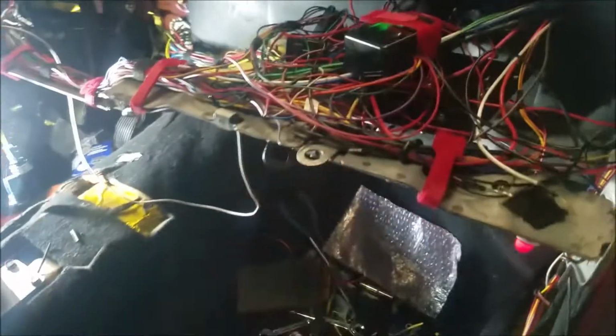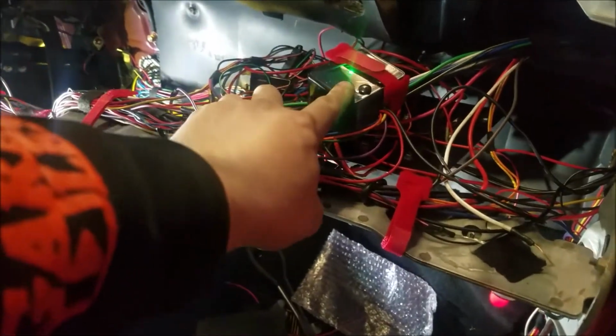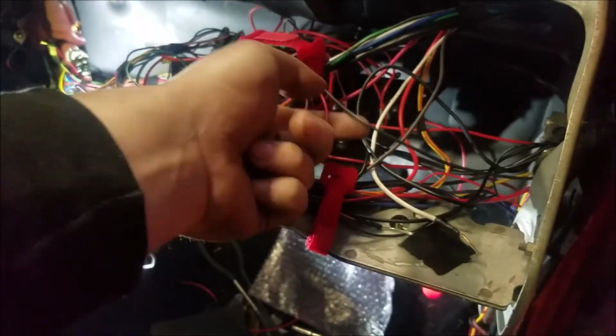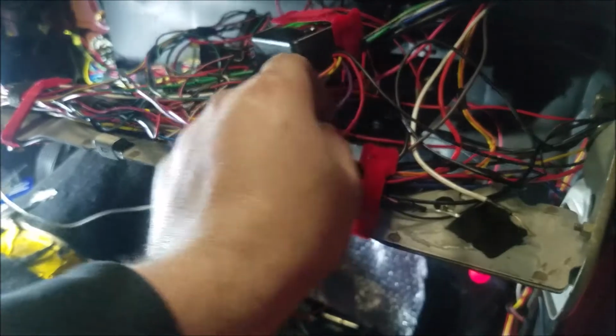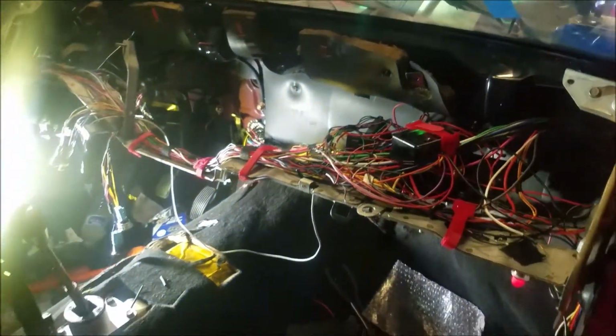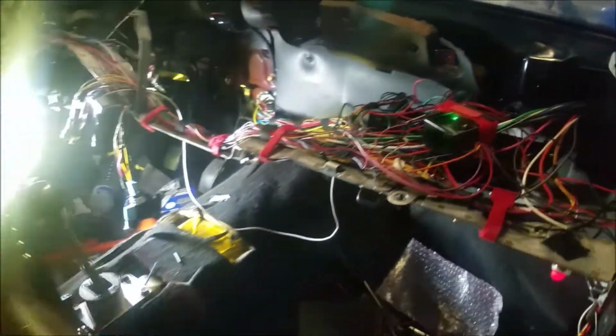If you look in this random video about Intellitronics wiring, even though it won't be labeled, we got the GPS in there. Black is ground, red is power, and then the purple wire gets hooked up to the white wire off of the actual gauge. So it's solid, which means it's working. That's good. Now we're gonna try and get the dash in. All right, there it is. The dash is back in and all.